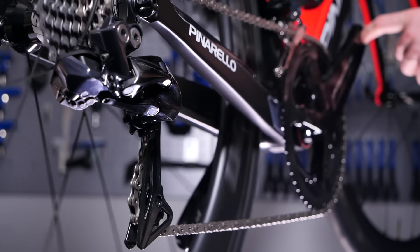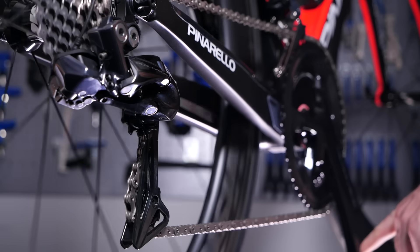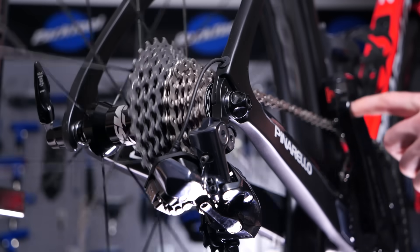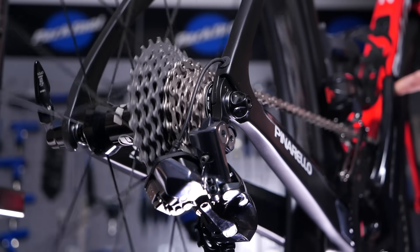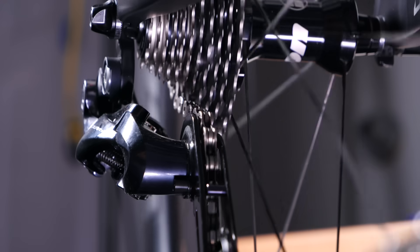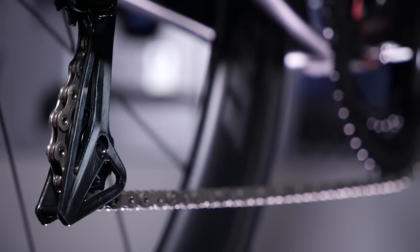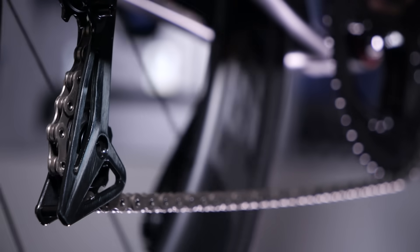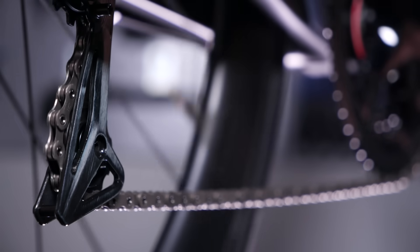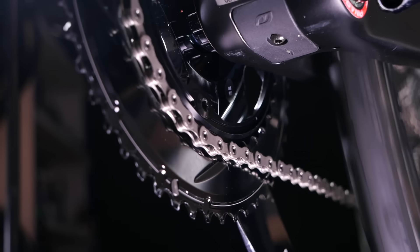The most high-tech components don't have cables, but are now self-contained electronic systems. Instead of cables actuating the gear change, the derailleurs move using little electric motors called servos. The rear derailleur contains springs and a cage with little pulley wheels that help guide the chain and, crucially, keep it under tension. This is important because without it, changing the size of the gear could make the chain slack and it would slip.